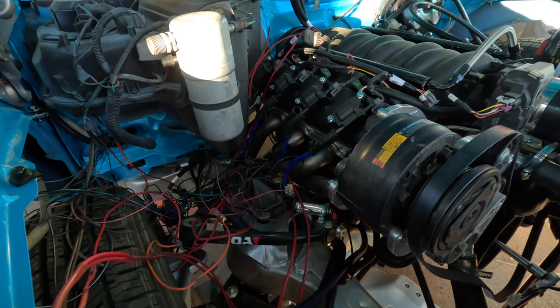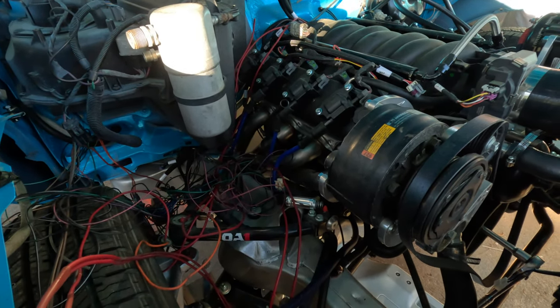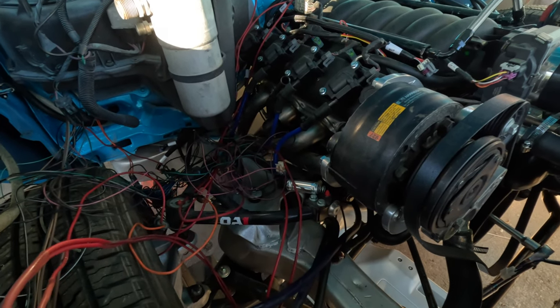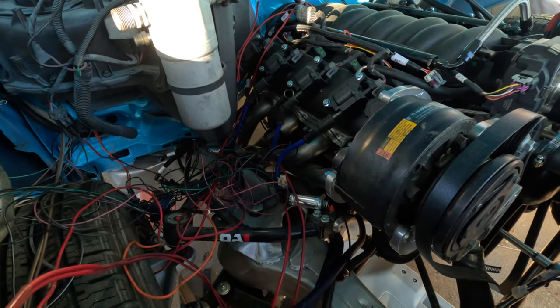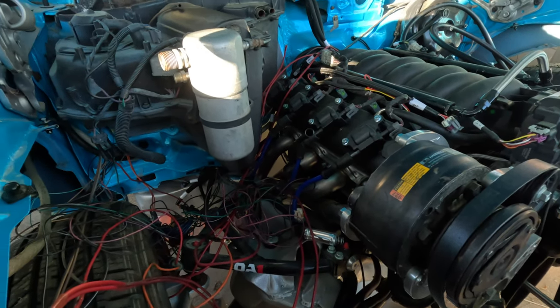I'm feeling like that starter's giving some resistance or something. Because if it won't turn the engine over now, and you ain't even got the transmission on it, it's sure not gonna have less trouble if you had the transmission on. All it's really supposed to take is that first initial crank, and boom. Once you get fire and everything, it's supposed to catch.